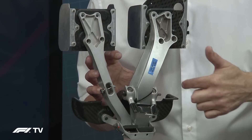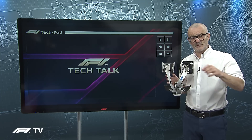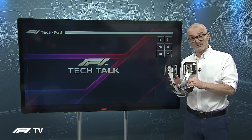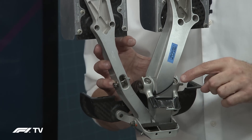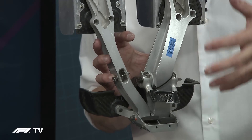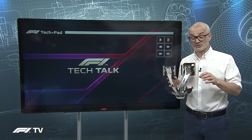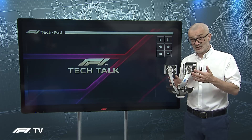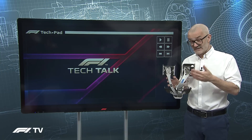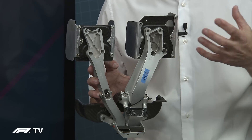Then you have what's known as a bias bar assembly which moves side to side and changes the bias of the brakes front to rear, and you'll see drivers adjusting units inside the cockpit to make that adjustment. Because the rear brake bias is looked after by the brake-by-wire unit, teams can have a much simpler setup — a tandem master cylinder with both front and rear at a fixed ratio in one unit. That simplifies the whole cockpit setup, with all brake bias adjustment done electronically through the steering wheel via the brake-by-wire unit controlling the rear brakes. The pedal barely moves a few millimetres, and it's the pressure on the driver's leg that modulates to achieve the different braking force.